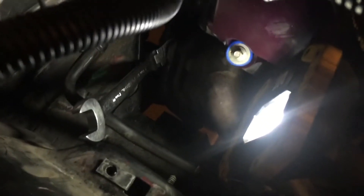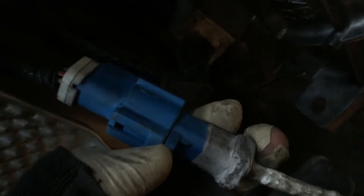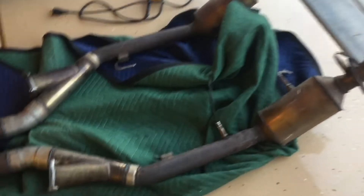The top exhaust bolt can be reached from the passenger side — otherwise it's kind of hard to get past the O2 sensor from underneath the car. The rear O2 sensors unplug the same way: push down on the tab, and if you put a screwdriver in between there and twist it, it'll help separate it. We're going to undo both of the ones back here.